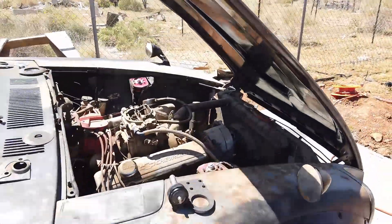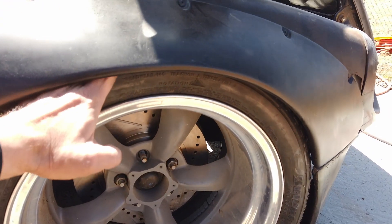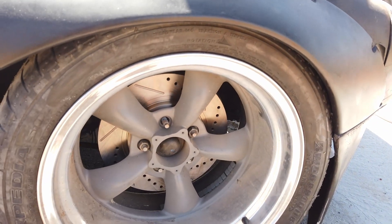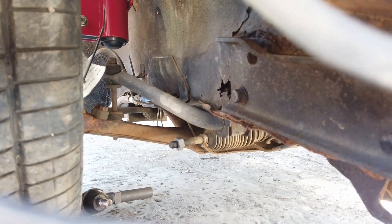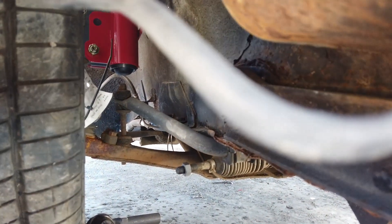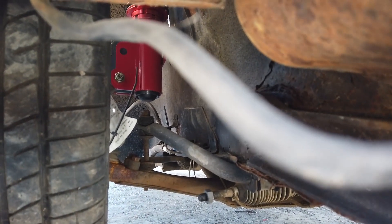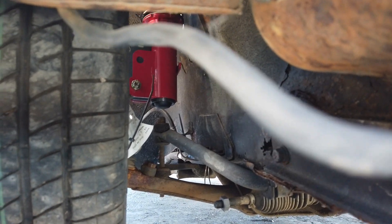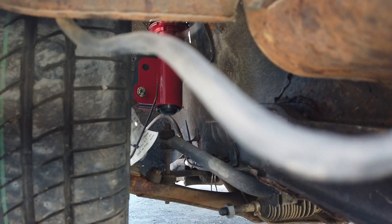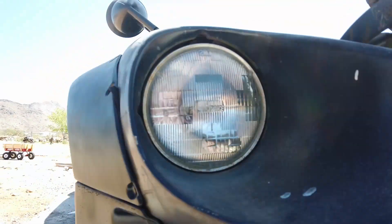My car's right-hand drive and I'm waiting on some tie rods. I'm going to be widening my track. With the Mustang setup, you can see how the control arm is facing upward — it's no longer parallel with the ground. For proper roll center it's supposed to be below parallel. That's with the Mustang ball joint and Mustang spindle, which corrects roll center by an inch just using those alone.